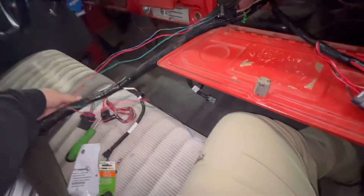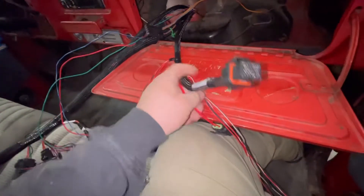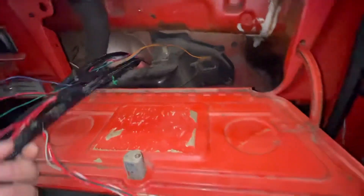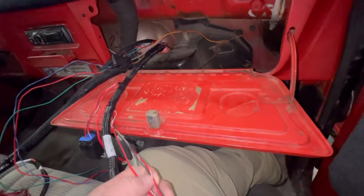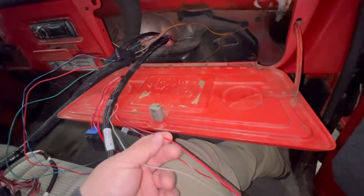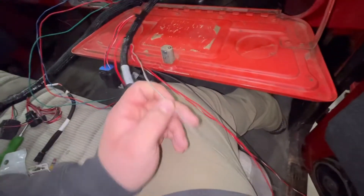Now that's all the ECU wiring coming in. And then we also have this harness, which is the transmission harness. This will plug in — it has a fuse and a relay built onto it. This is all going to be tucked in down here underneath the dash. Now this harness has a flying lead coming off of it as well, so you have switch power, ground, constant battery, and this is the brake signal switch for the transmission.